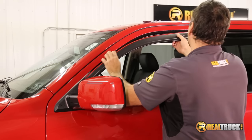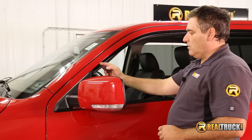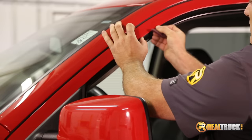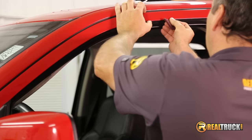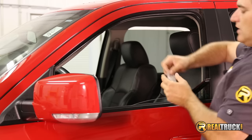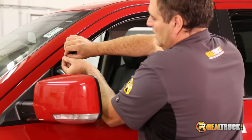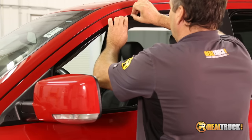So what we're going to do now is take this back off and then take the little scrub pad that came with our kit and go around on the inside underneath here between the rubber seal for the window and the frame of the door — just scuff that a little bit in there. That's going to get all the dirt and everything that might be piled up in there out, so that way we know our double-sided tape is going to stick properly. Then we're going to take our alcohol prep pad and do the same thing between the window seal and the frame of the window to get it cleaned up really nice and ready to put the visor in.